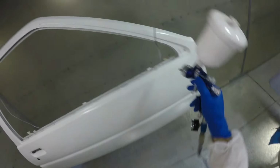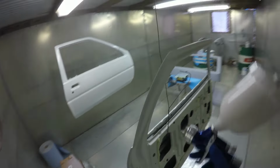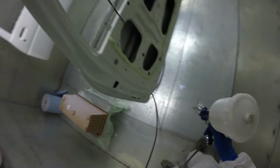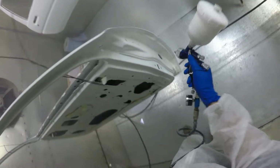Due to the paint not working, I ended up buying a matte black for my front and rear bumpers. And the guys that sold me the paint at my local automotive paint supplier recommended that particular paint, and it was all well and good, but the hardener that they sold me with the matte black was reacting to the paint, and it just wouldn't dry. It stayed sticky for 2-3 hours later. It eventually would dry, but it never ended up drying in a nice matte finish. It stayed like a shiny satin finish, which I wasn't happy with. Yeah, that just ended up being a bit of a debacle, and having to mess around with that.